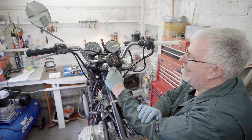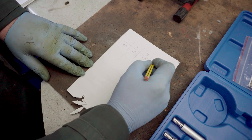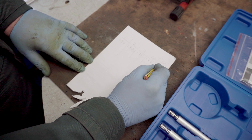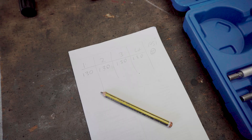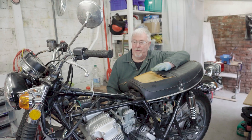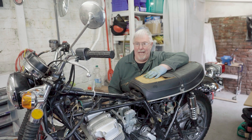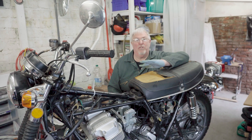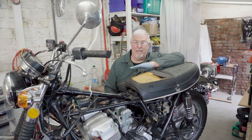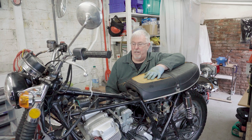Another 130. Nearly all of them would be exactly the same 130 — I'm really pleased with that. I'm really thrilled with that actually. The wisdom is that they should be over 100 psi and within 10% of each other on a healthy engine. Well, they're at 130 and they're all at the same pressure, so I'm quite happy.